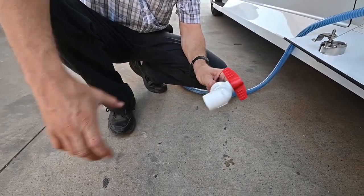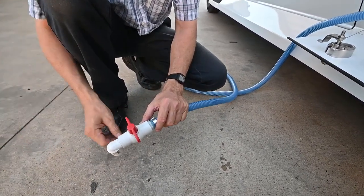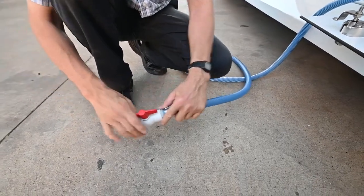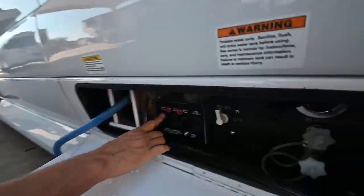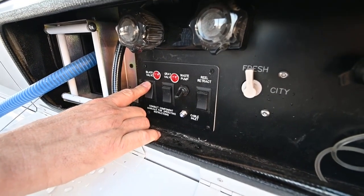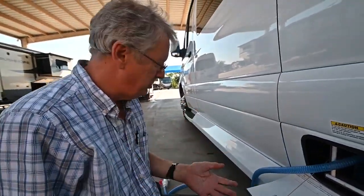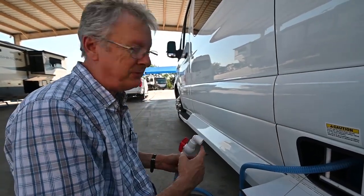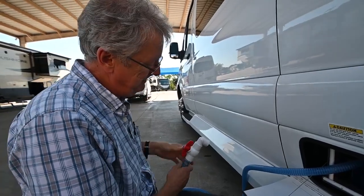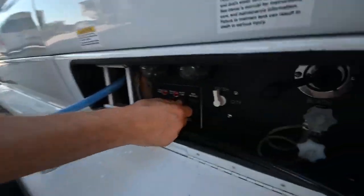They make something called a donut that would go on there - you slide it on and that will seal up in the sewer to keep any sewer gases from coming up. When it came time to dump, watch the gauges inside - when the black tank's full, open up the black tank. I've opened that up and now I would turn on my macerator. This is a macerator system - it's going to grind, chew, and pump everything through this little small hose. Potentially I could hook another hose up to this and run it out 50 feet, or go uphill at least 10 feet - that's the advantage of the macerator system.